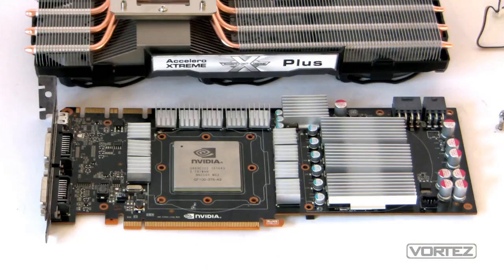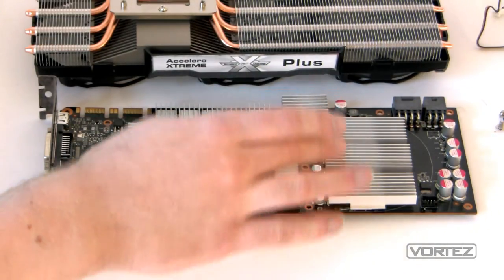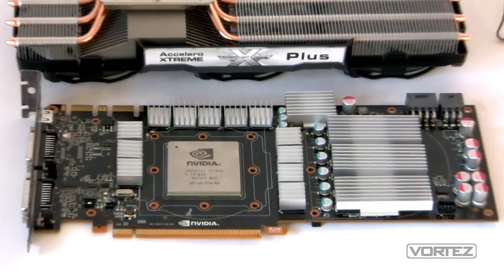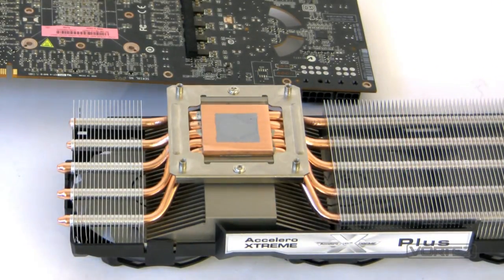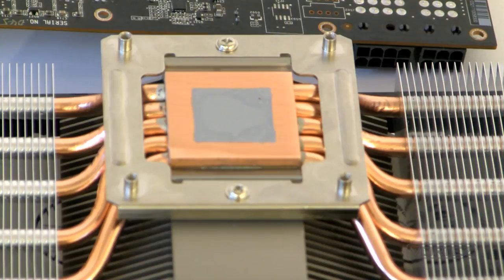I've finished installing all the heat sinks onto the board. These cover the RAM chips surrounding the GPU, and also the voltage regulators on the far side and top of the GTX 480. To get those on you need to make sure the old grease is removed, and you should use an eraser to create a good surface for the adhesive to bond with the heat sink. All that's needed now is to replace the mounting plate and fit the cooler onto the graphics card. The default mounting plate pre-installed on the base plate probably won't line up with the holes on your card — for the NVIDIA GTX 480 I had to use the mounting plate provided in the VR004 accessories kit. With that installed, I just need to drop the card onto the cooler, put the washers on, fit the screws, and we're good to go.